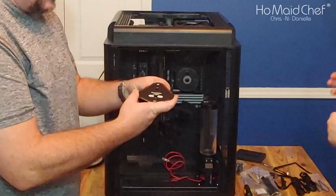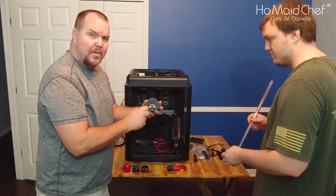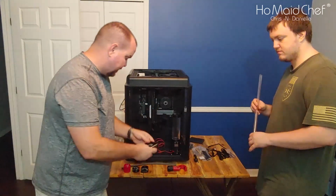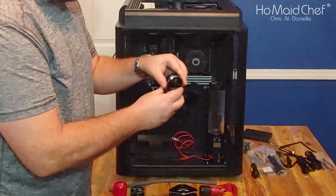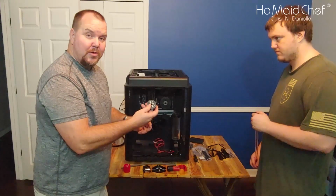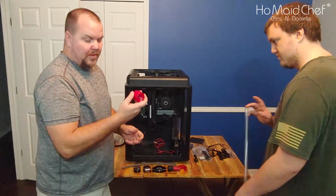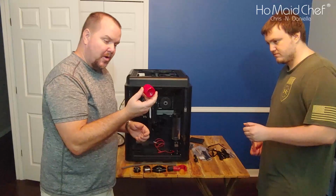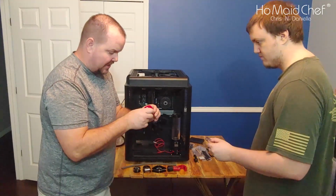Now, your 90 and 135 benders, these are metal, so you're not going to burn these with the heat gun. Here is the 180, same material. And then you can go full circle, or 360. Also, if you do get some burrs on your pipe when you're doing this, it has a deburr. And this one looks like it has razors inside.